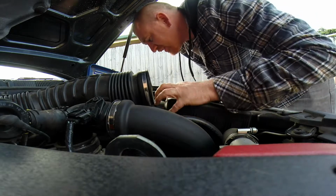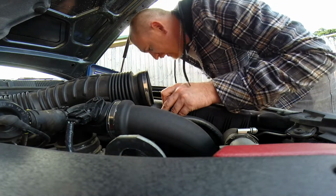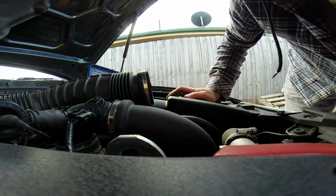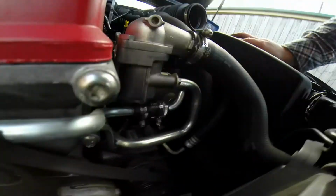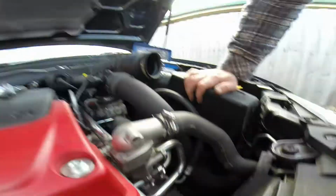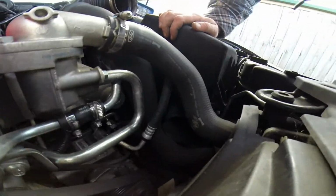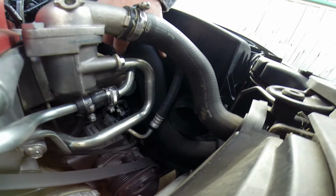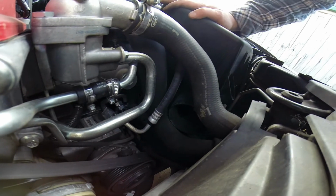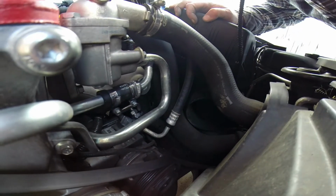Alright, so that sits there, that sits there, they're all lined up. Now, there's one of the problems. Your intake piping coming from your intercooler, as you can see, that's touching. If I move the box, that's flexing that pipe. It's only plastic pipe. You know, vibrations in the car, plastic on plastic, slowly vibrating. The potential for a wear there.